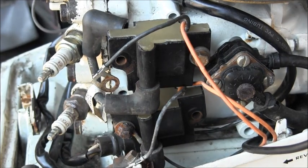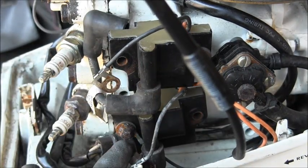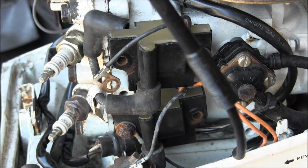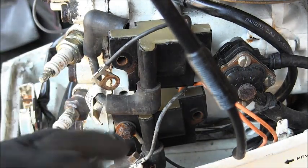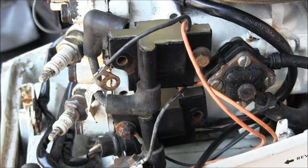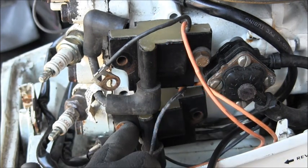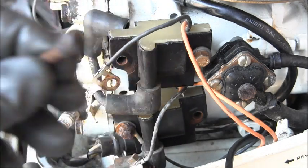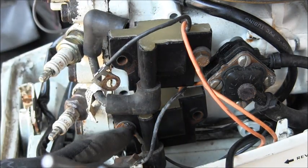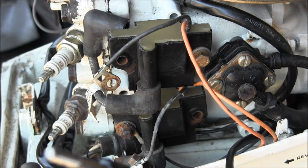Okay, now I want to perch something out here. Now, as I'm going through these and I'm taking care of this cable, look at that coil bolt right there. See how bad that is, corroded and rusted? This one was the same way. There it is. Now, if you look over here at this one, you can see how nice that is. But this one, and this one look like that. When you're going through one of these old kickers and you see stuff like that, get it out of there. Get it out of there. It don't belong in there. And it's all rounded off.